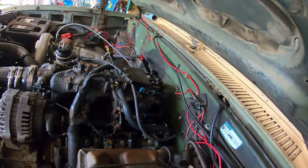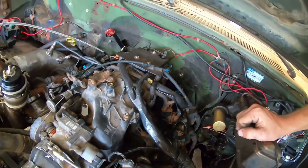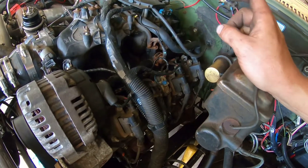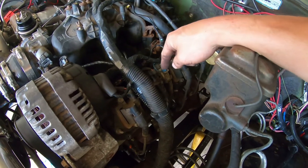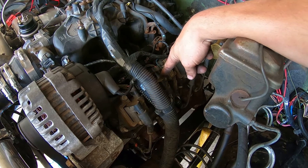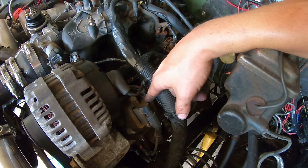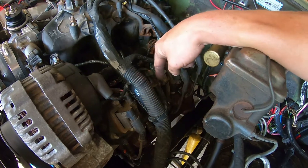We've got our covers off. The truck this engine came out of was a snow plow truck from Pennsylvania, so there's a lot of rust. I've already done all the quick diagnosis to isolate these misfires. On cylinder number three, I verified the misfire by unplugging the coil pack — it didn't make any difference in how the engine was running, so I knew it was misfiring. I then unplugged coil pack on cylinder one, and it made a drastic difference, confirming cylinder one was firing and cylinder three was not.